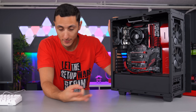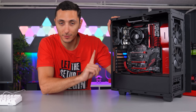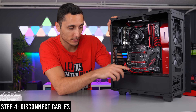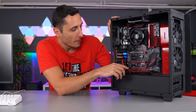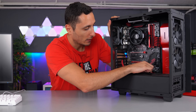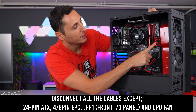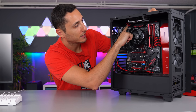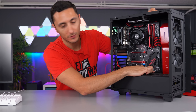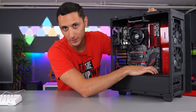Now we've narrowed it down to three components: power supply, CPU, or motherboard. Before we test any of those, we've got to make sure to disconnect everything from the motherboard. If you're using extension cables, now is the time to bring in the original cables for the power supply so we can test those as well. Disconnect any storage devices, any USB ports for the front IO. Everything is disconnected except for the 24-pin for the motherboard, the 8-pin CPU power connector, the CPU fan cable, and the front IO — make sure to leave those on.